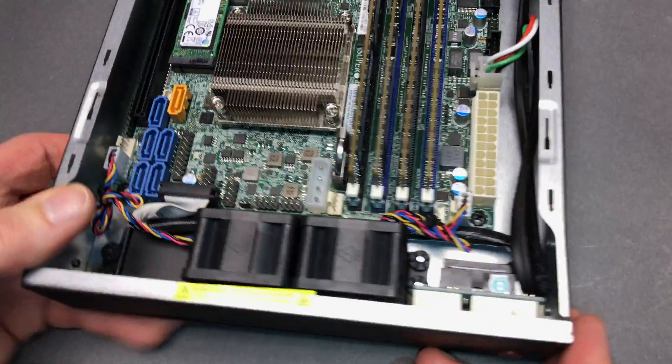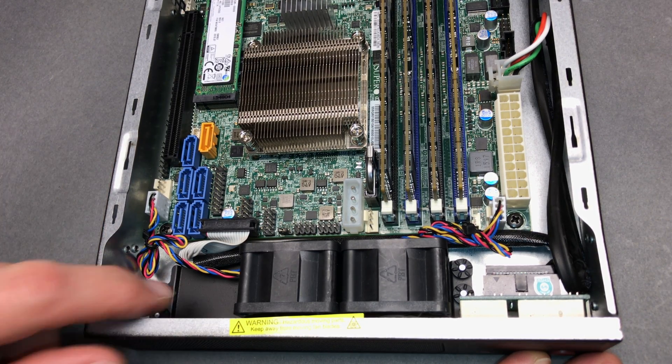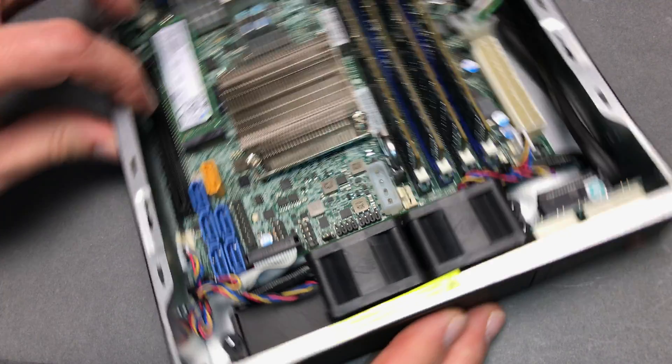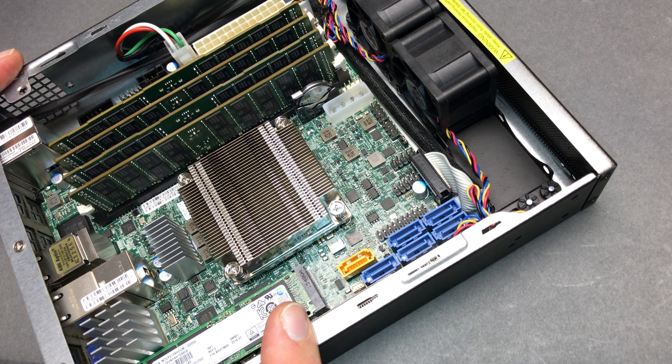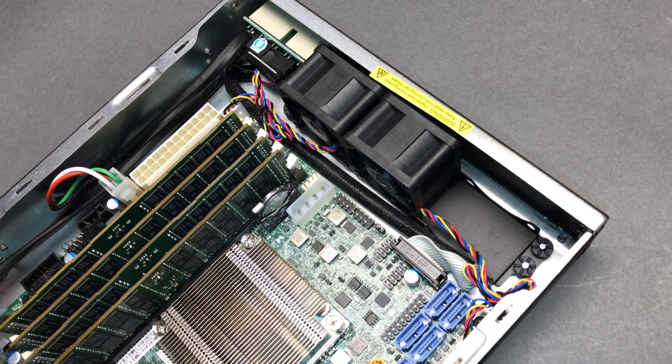That's it — just a little bit of minor rerouting advice if you own one of these systems. I'm going to have to give this loaner eval unit back very soon, but I might consider stealing a fan from another unit, putting it in the third bay, and seeing what that does to the IPMI-controlled fan speeds during a benchmark, Prime95, or video render job. But for now, that's it for this video — just quick fan and cooling tips on this 6-core Xeon D system. Thanks for watching and for visiting Tinkertry.com.